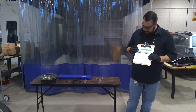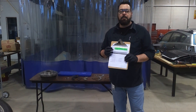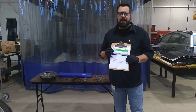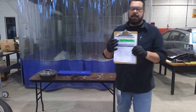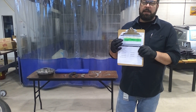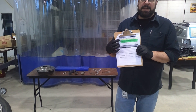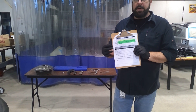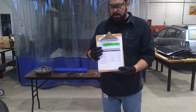Now we're going to talk about the bonded brake lining and riveted brake lining measurements on the PA state inspection. That would be the green highlighted fields under the yellow — that's where we want to make those documentations. Pretty simple, pretty straightforward, but I'll demonstrate for you and we'll get it going.